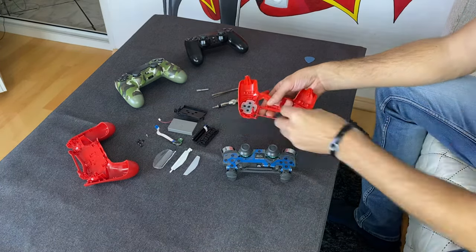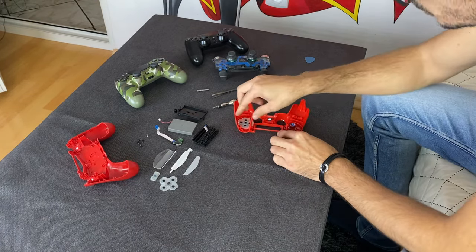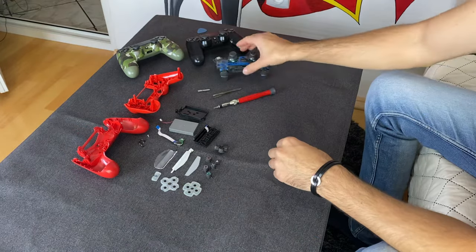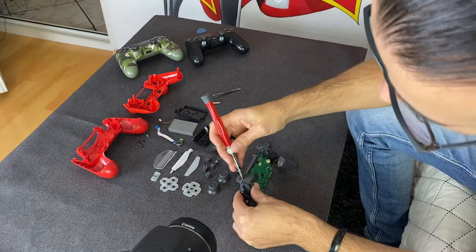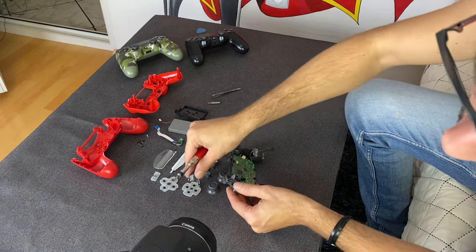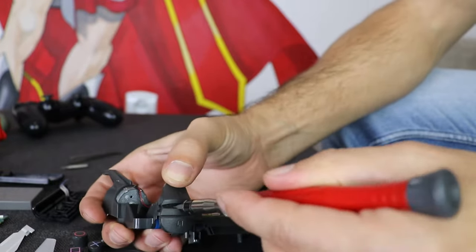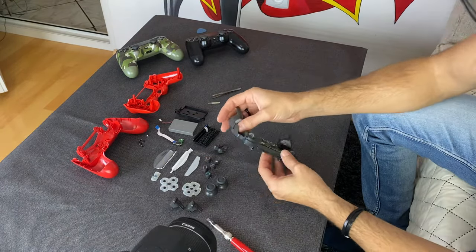On the upper case is the touchpad, which is quite easy to remove, along with some silicone pads and some of the plastic buttons — also easy to remove. The thumbsticks will come right off by pulling them away from the board. When removing the left and right triggers I found it easy to use a flat screwdriver. Push the button, insert the screwdriver, and twist it on both sides of the button. It can be done only by pulling on the button with your bare hands, but I feel more in control using the screwdriver.